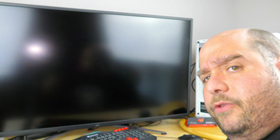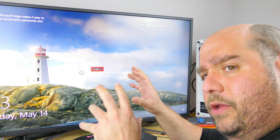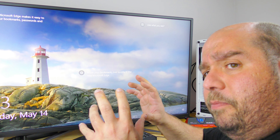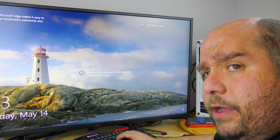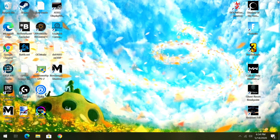Now we're going to turn on the computer for the first time. When you first turn on your computer after switching video cards — going from NVIDIA to AMD or AMD to NVIDIA — your image might look a little different. It might look smaller or bigger, fuzzier. Don't get freaked out — that's perfectly normal. Coming into Windows, things might look a little odd, the display large or blurry. It might look incredibly weird. Don't worry, that's normal when you're switching GPU brands.